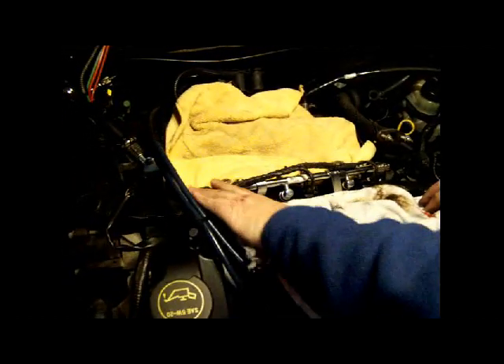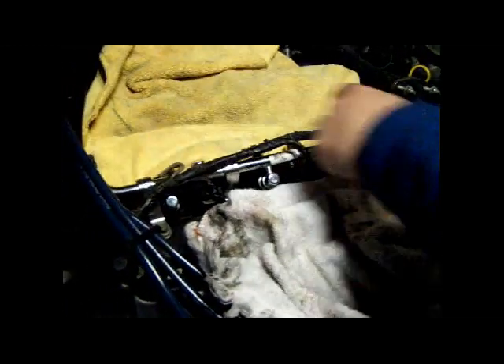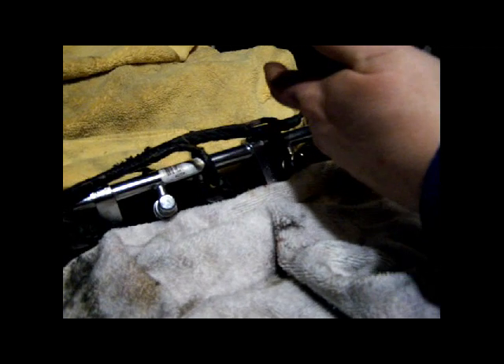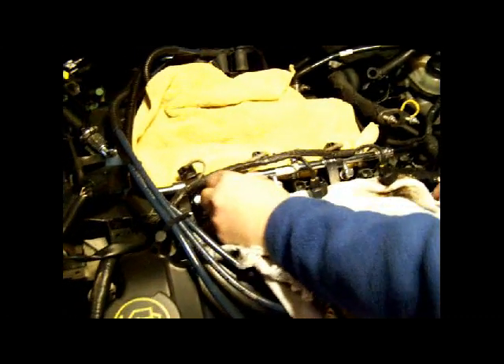What we've done is we've exposed the fuel rail — this is the fuel rail right here, the silver chrome pipe. You can see where the injectors are connected to the fuel rail. There are six of them; this is a six cylinder engine with six injectors. Each injector has a set of wiring on it, which is just these caps. These caps come right off — you just squeeze this little piece here and you can lift it right off. We're going to disconnect the electronics from the fuel injection here because we need to get to the point where we can remove the fuel rail. So I'm taking all six of those off. They just pop right off when you push the pin, and now this wiring harness is free.